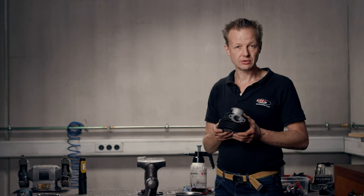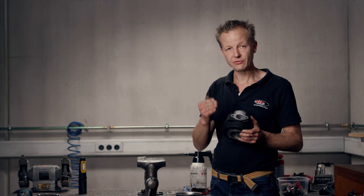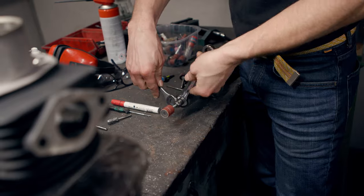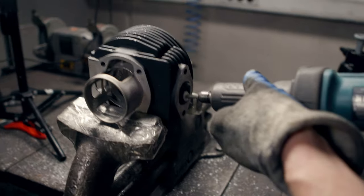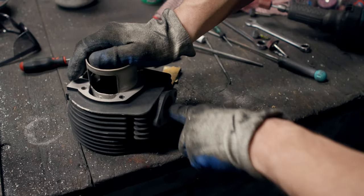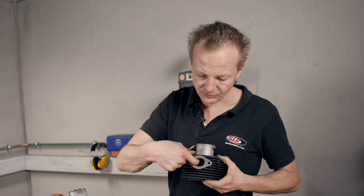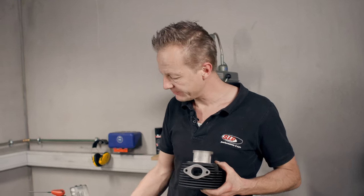This is actually very cool — I can easily do the finishing of the surface, and I think it will still remove some material, getting those 2 or 3 degrees we are missing. The top edge of the port window is now rounded as I like it, and I've smoothed the surface with finer sandpaper. From my point of view, the porting job is done.